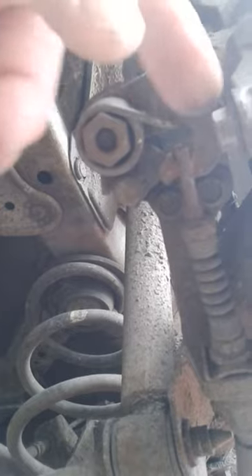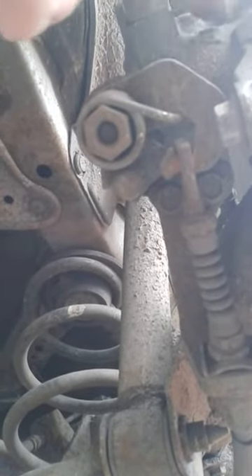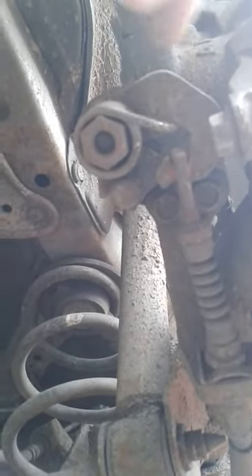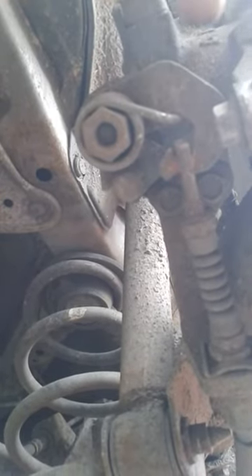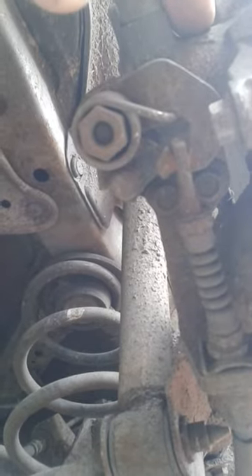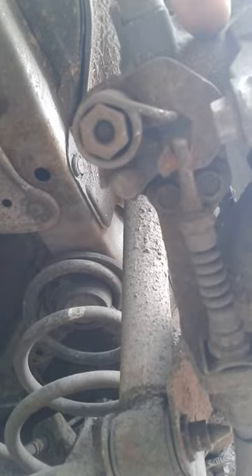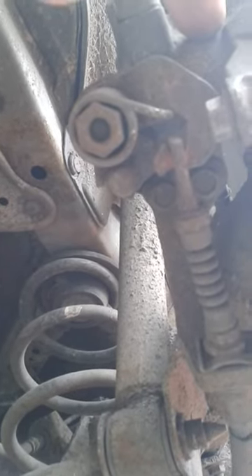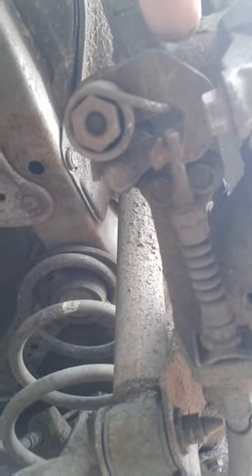So there's actually a mechanical linkage between your handbrake cable all the way through the caliper to that rotating block that you saw before — basically the piston in the caliper. So absolutely no sense in trying to push the piston back on these rear calipers, because the stop is a mechanical one, not just one that naturally occurs with the front brake servo action.